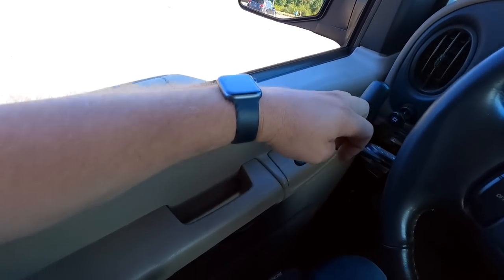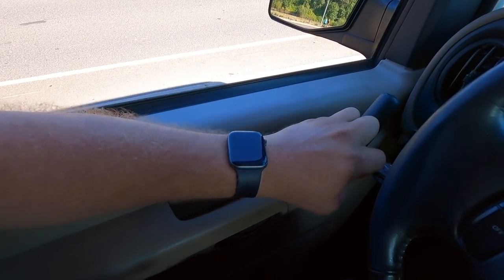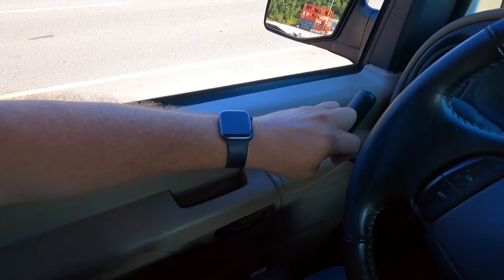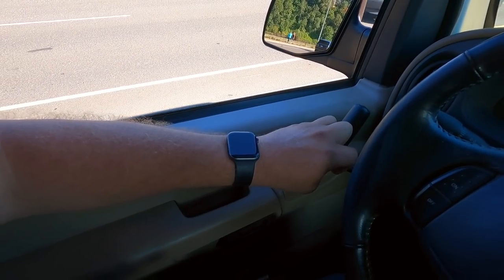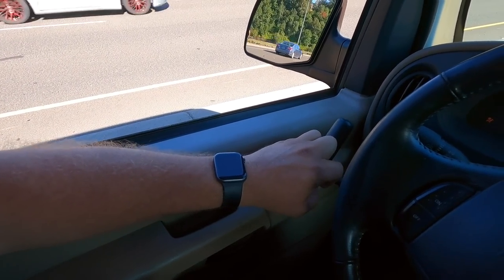The trip back to the bus was a little more eventful than I was planning. The window mechanism just broke and now the window has descended. I don't think the glass broke — it didn't fall down with that much force. As I recall, we replaced this mechanism on a live stream and in a video. I think the cable just slipped off, so we're going to take this thing apart now.